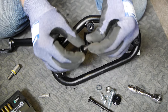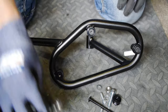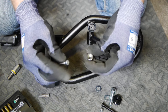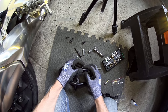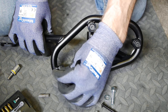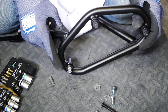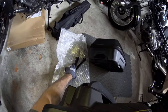Same again for the next black countersunk bolt into the bobbin, a little bit of threadlock and into the lowermost threaded hole, tighten to 8 newton meters. Then for the foremost hole it's a slightly different setup — a pan head bolt that goes into this little chamfer-fronted recessed collet thingy, and that goes into the last of these aluminium bobbins and into the foremost hole. 8 newton meters of torque. I do believe the reason why this front one is different and stands proud is because this is part of the locking mechanism, as these cases are actually lockable once they're on the bike.